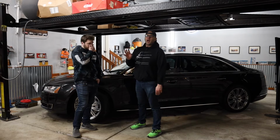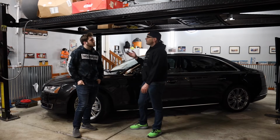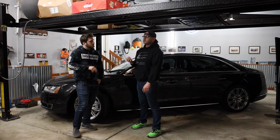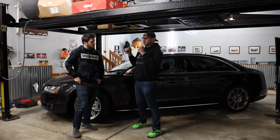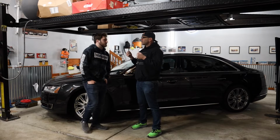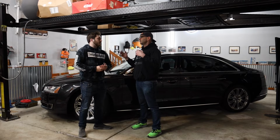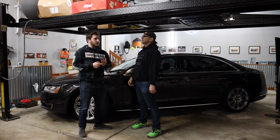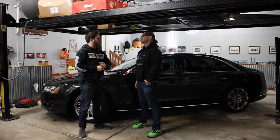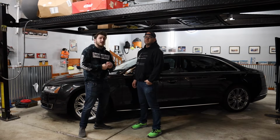There you go. Now what I would add to what you said previously, I was only hearing this squeaking noise when I was going over a bump. There was no clunks, there was no looseness in the steering wheel. So that would be another indicator of an actual control arm, if there was something clunking. Clunks, it would usually come down to either A, sway bar links, or B, something with the strut.